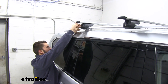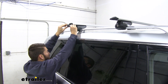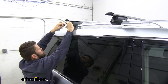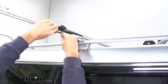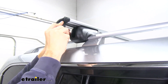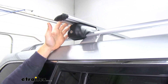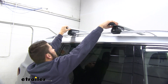We can get that end cap tool off right here and use it to tighten both sides down. You can see how I have the foot bumped up against the support part of the raised side rail — that way I don't have to measure the crossbar spread, I can just line both sides up with that and know the crossbar is even. There's a good amount of pressure, so just one more turn. Then store the end cap tool back in, line it up, grab your key, and lock it up. The other side is already done, so the roof rack is secure. I like to grab both crossbars and give them a good shake to make sure everything is secure.